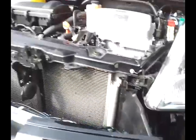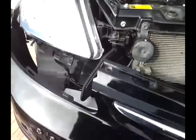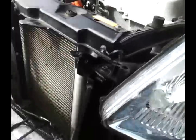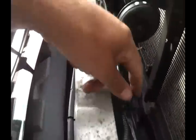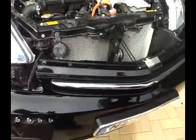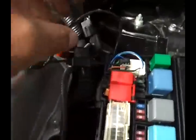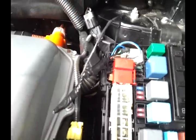People may say that it's very easy to fit daylight running lights — and the same for mobile phone hands-free, for instance — but the truth is it's very easy to fit them badly. To actually do a nice tidy job, you need to cable tie all the wires up, remove what's necessary in the car — the bumper, the headlights — and refit them as required, and take a nice power supply fused appropriately as well.